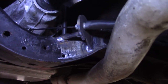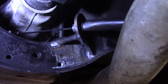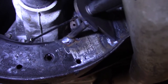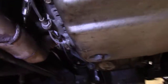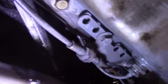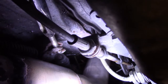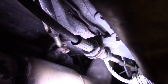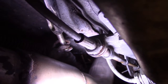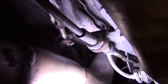I got the emergency brake cable hooked up for the passenger side. I've got a little bracket here with a tubular gusset on it to hold it in place, and the connection to the emergency brake cable through that solid linkage is up here. You can see the turnbuckle for the connection and then the factory Mazda linkage hardware right there. I think the geometry will actually get better when I have equal tension in the cable system for the driver's side. I'm going to use the same method tomorrow for the driver's side cable. Pretty happy — I'm going to have an emergency brake back.